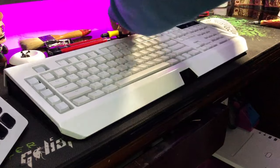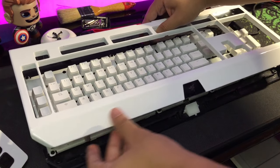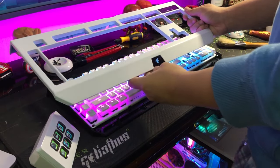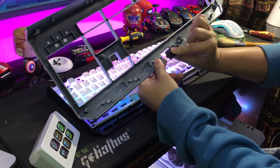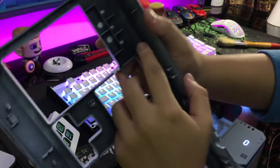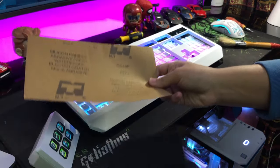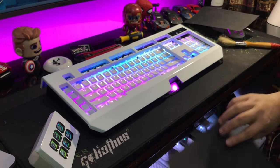You're actually going to be surprised by how much dust build-up there is on the keyboard. Give it a nice little wipe and you're good. Now, separate the Razer logo from the case — just put a little bit of pressure on the left side of the logo and it should pop right off. There's also the caps lock and number lock indicator on the top right of your case. Don't worry, it's just a sticker — use your screwdriver and pry it off. Then sand the case — rough sand it first, then smooth it out — and you should be ready for painting.